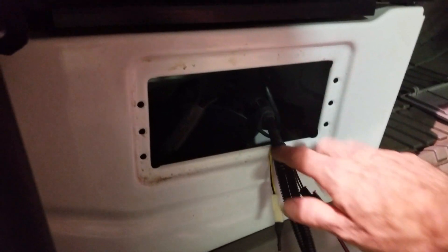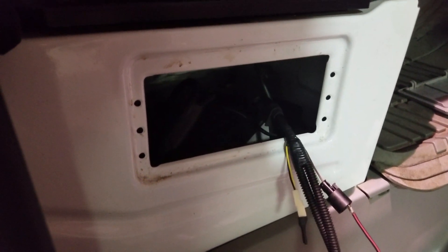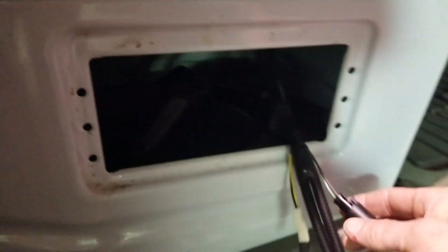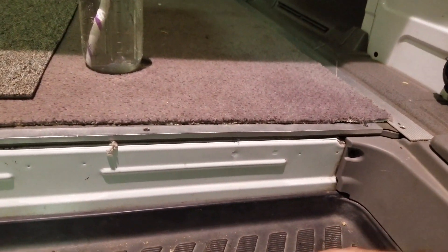I did this first before wiring in the Webasto heater's wiring harness — it'll get tucked away underneath everything later. This is a long wiring harness. The furnace is right in there, and about a foot back on the harness is this pigtail — that's the wiring for their diagnostics tool. Webasto says to ground that, and it's still blinking.